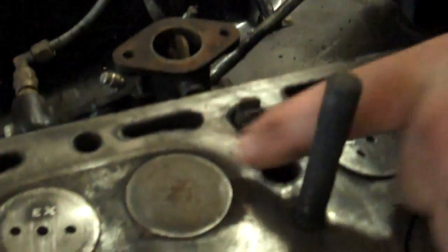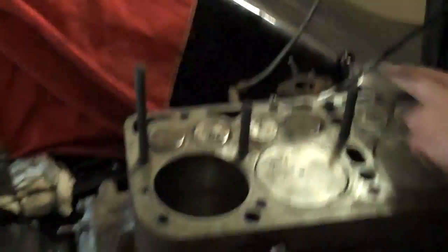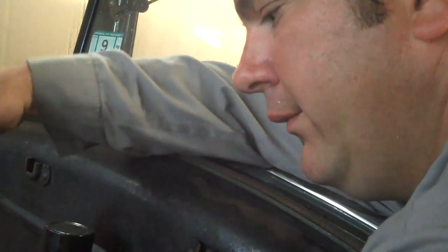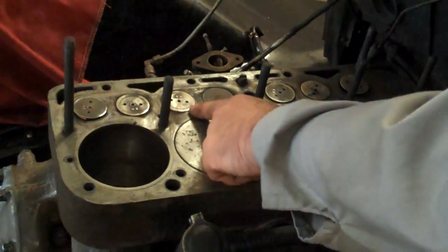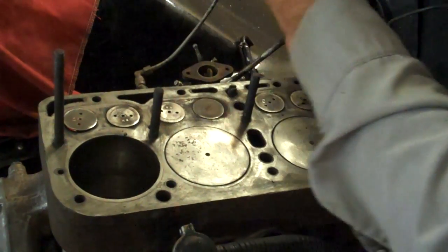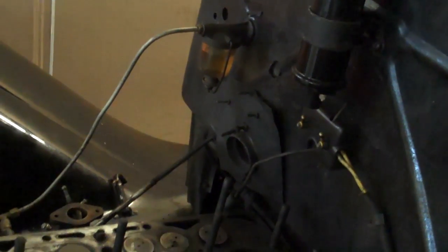The distributor was a little quirky in the cylinder head. The cylinder head houses the distributor on top, and this shaft drives the distributor — it spins off the oil pump, driven off the crankshaft and camshaft. The distributor wobbles in the bore of the head, which makes me wonder if it favors one side because of the bushing play inside. I'm wondering if the spark lead is what's causing the detonation. If the distributor shaft is worn at all, it can cause spark scatter to occur.